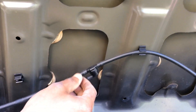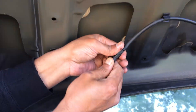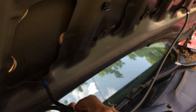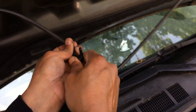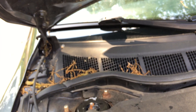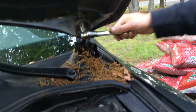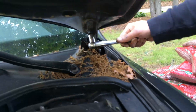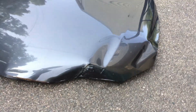What we're going to do is unhook the washer fluid lines right here. At this point we should be able to unhook the hood, so let's do that. We got the hood off — we just needed a 12 millimeter bolt on this 2009 Camry.